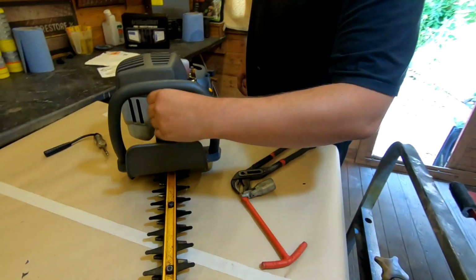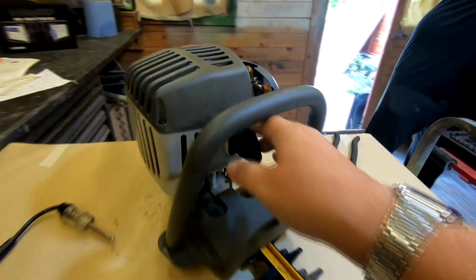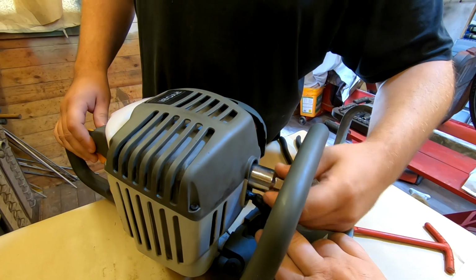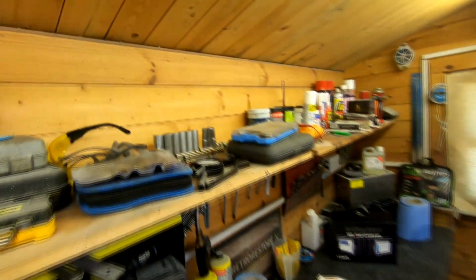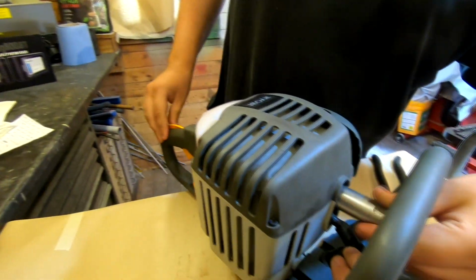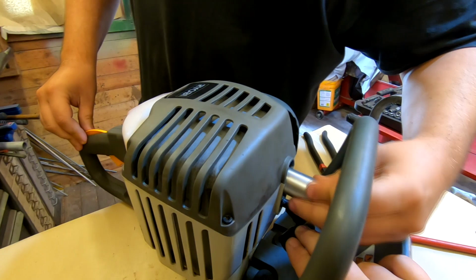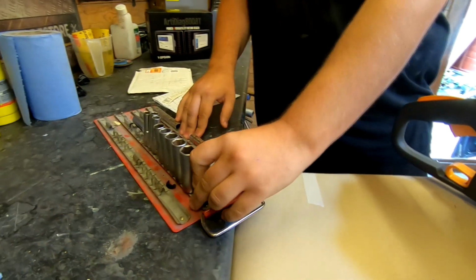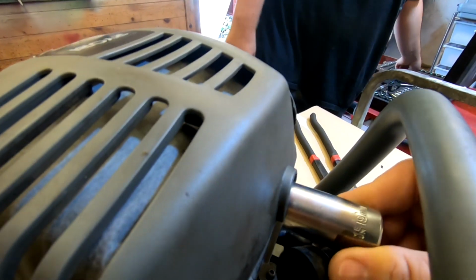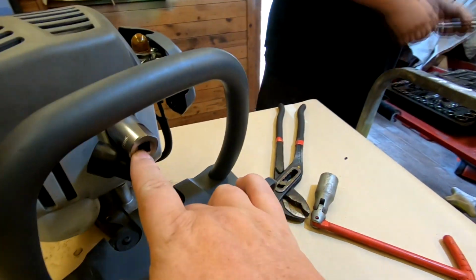Right, two spark plugs in the top. Is that the one? Oh, you have to use it up there, long reach. Long reach sockets. I've got everything here somewhere. Spark plug sockets, hey? Try one of them. That's the kitty. What size is that, just for the record? 19, is it? 19 mil, yeah. It's a 3/8 drive.